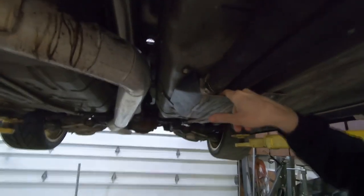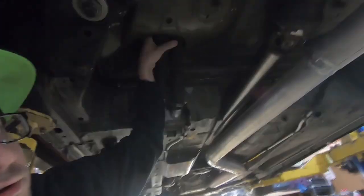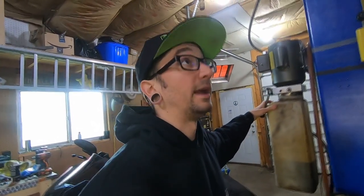We have our two one-and-a-half inch hoses that come up under here. We put a nice little skid plate here to protect the box, but we have an aluminum box that the lines go into to come up into the car. Once they're in the car there's an enclosure — they don't run very far, then they come back out right here and go back up in the rear. This was primarily done just for the ergonomics of the routing to make it all simpler and easier. There are enclosure panels on the inside of the car as well. So you need to have hoses run all the way back, and I'm running one and a half inch hose all the way to and from.